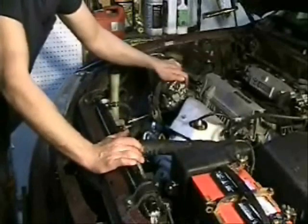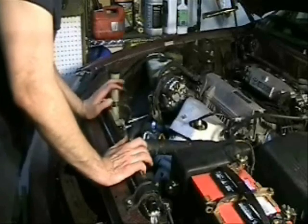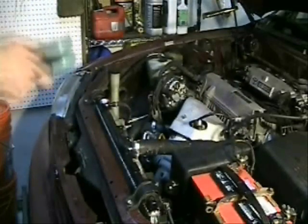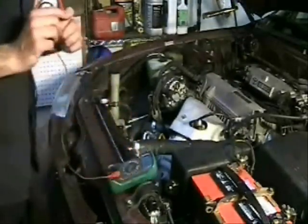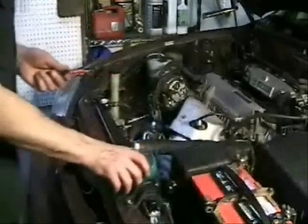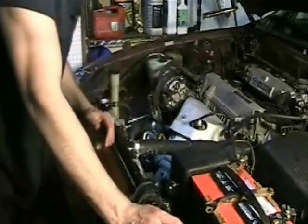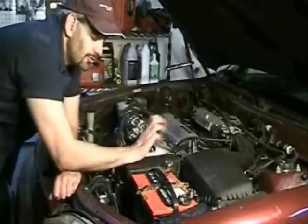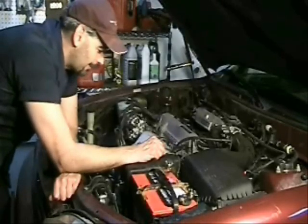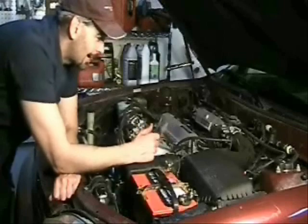On the positive side, I can see there's a brand new alternator on here and everything else looks to be in very good condition. While the engine is running, I'm going to test at the battery with a voltmeter and make sure I've got over 14 volts — that indicates the alternator is working, and on this car it is. At this point I'm pretty satisfied that if we test drive this vehicle we're not going to end up stranded, which protects both me and the owner from any argument over who's responsible for towing.